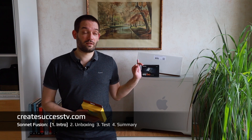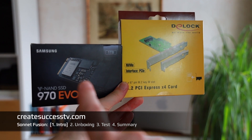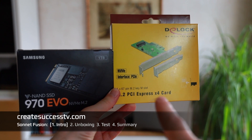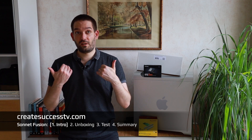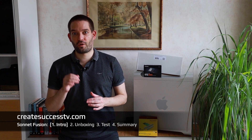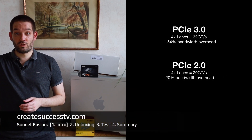What I found out is that the NVMe actually uses PCIe 3.0, so when you're using the four-lane adapter card, the data goes from the PCIe 3.0 four-lane NVMe to the adapter card, which is also four lanes, and then goes into the PCIe 2.0 in the Mac Pro. That obviously won't give you the full speed that the NVMe is capable of, simply because PCIe 2.0 cannot transfer the same amount of data as PCIe 3.0.